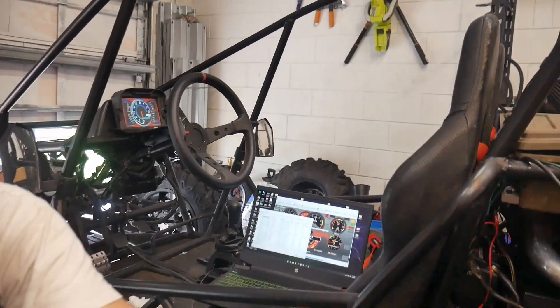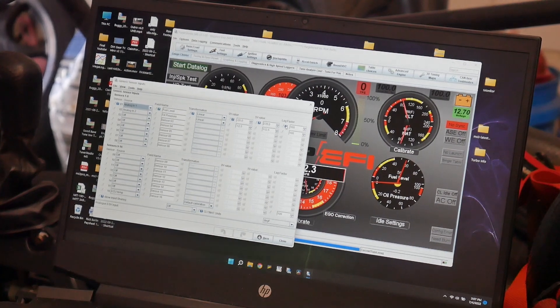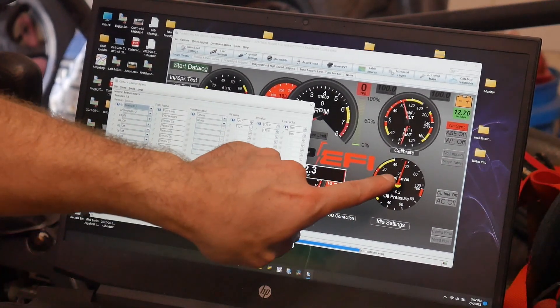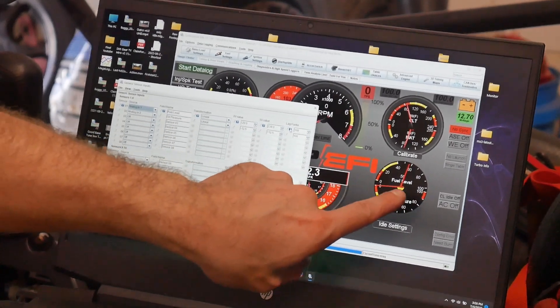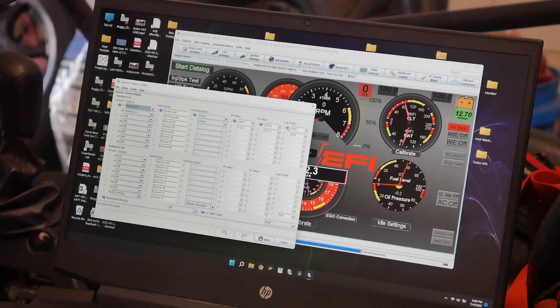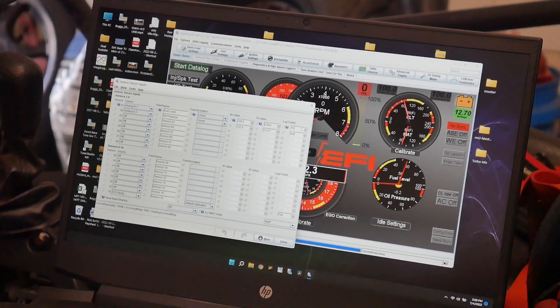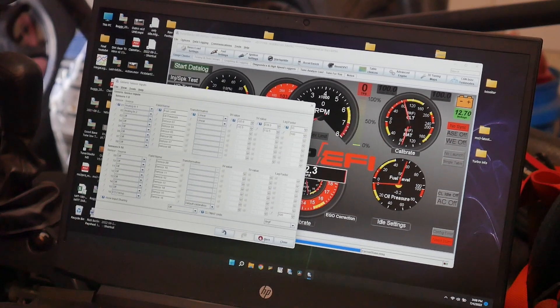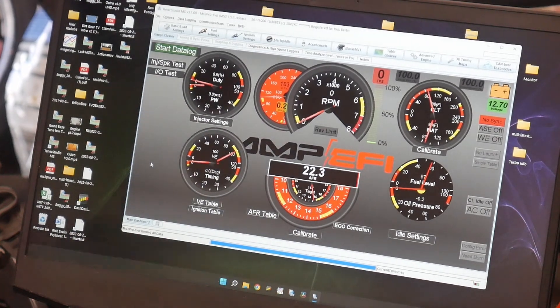I got the new fuel sensor set up. Watch the fuel level when I shake the buggy — you can see it dancing around in there. What I'm going to do is put the maximum lag factor into this for the fueling — a lag factor of 15, that's maximum smoothing. Ice cold engine, let's see if she starts.